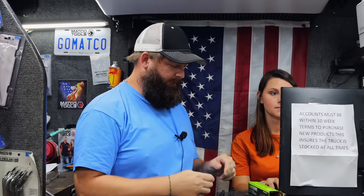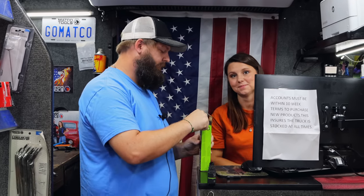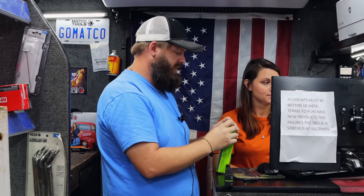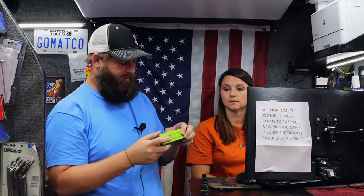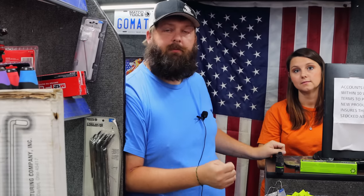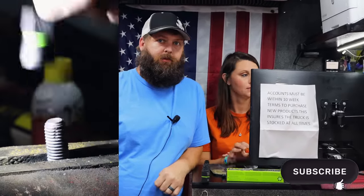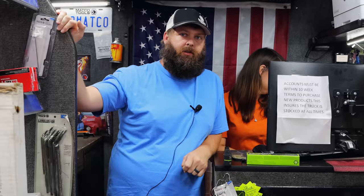I did a video on those and a lot of guys were like, 'Well, I got bolt biters that are the same thing.' No, they're not. Bolt biters specifically — they do not hammer them on because they're thinner walled and they will bust. And the twist design — if you've got a broken stud, maybe a quarter inch, half inch sticking out, the bolt biters don't work like those designed to go on. And if you've got a longer stud that you may need to reuse, you can actually reuse it with those because it doesn't mess the threads up. It does leave little marks going down it, but you can thread a nut right back on it, it's no big deal.